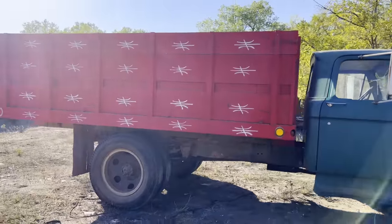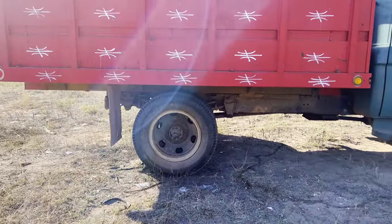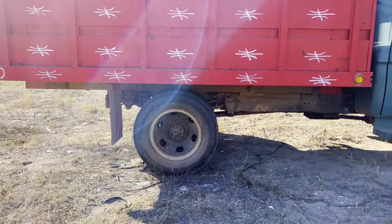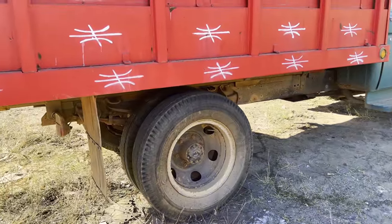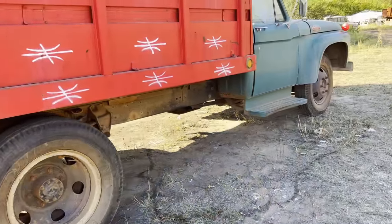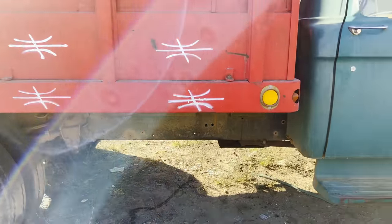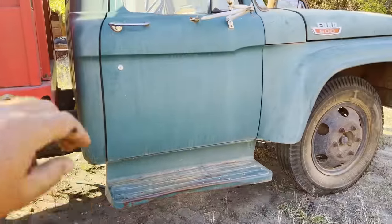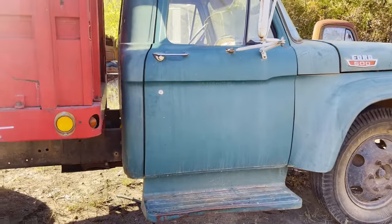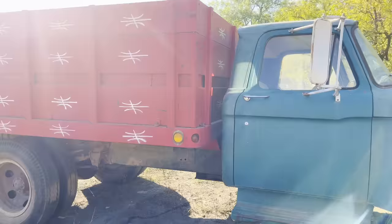And then the rest of the truck, what I kind of liked about it is it's just got those six-lug wheels in it. I have a set of six-lug non-split rims. They take tubeless tires, so I can take these off here, throw them away, and put some tubeless tires on the back of this. And I think I'm going to go ahead and section the frame. The cylinders and all the hydraulics look to be in really good condition on this. And the pump and everything, I bet it works, no problem. So I'll section the frame, turn it into a trailer hitch, and you put a little Predator engine or something like that on there to run the hydraulic pump, and then I can use the bed.